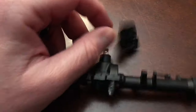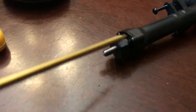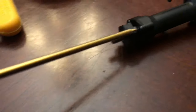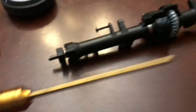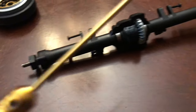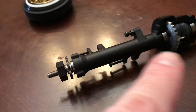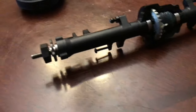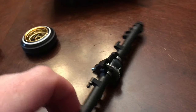The differential cover can just come right off, and there's the differential with the grease on it. Next, we're going to remove these caps on each side of the axle — there are three little 1.5mm screws holding those in. Then we'll be able to slide out each axle from the differential. This piece is loose; now I'm going to slide the axle out of the differential. Make sure that you keep track of what side things were on — this is the passenger side axle.